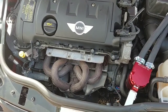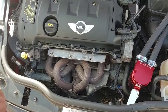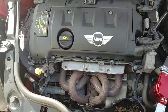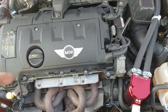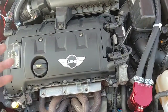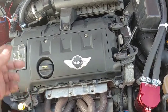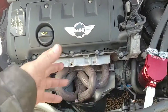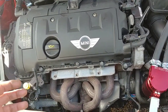I've tried just about everything. The temperatures on the catalytic converter are correct — it's not plugged — about 375 degrees at the inlet and about 585 degrees at the outlet. The upstream O2 sensor shows good values, the downstream O2 sensor shows good values. I've sprayed all kinds of cleaner in there, put catalytic converter cleaner in the gas tank, even sprayed lacquer thinner into the intake to help clean it out. Nothing's working, so at this point I believe the catalytic converter is probably bad but there could be some fouling on it.